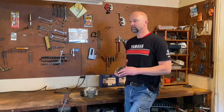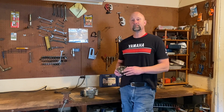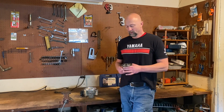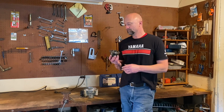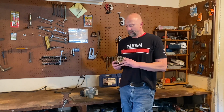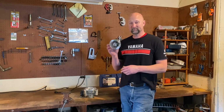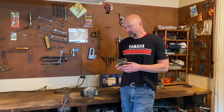So you need to build up things like your steering rack, your tie rods, ball joints, preferably heavy duty axles. And whenever you start running into things like that, you're weakening your front diff even more. So if I was a portal guy, I would definitely be looking into getting this chromoly carrier with the billet spider gears for sure, just to save my front diff. And East Coast guys, this is the answer to your front diff problems. I'm feeling pretty confident in that.